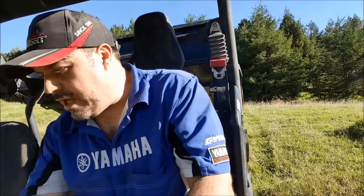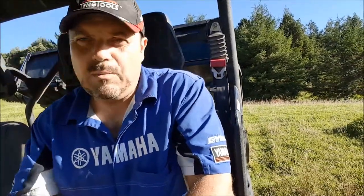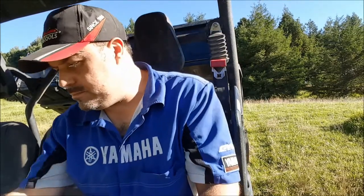Now, just while we're on the bank side, we're going down a steep hill now. If you put it in neutral, put the handbrake on, that's holding us really well. That tells me that that handbrake adjustment that we did on one of the previous videos when we rebuilt the parking brake, that's working really well. Two or three clicks on the handbrake lever, and it's holding us on probably about a 30 degree slope. We'll try it again when we're pointing up the hill.